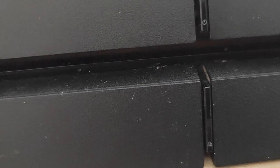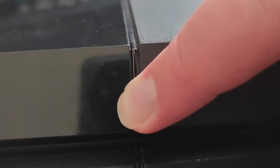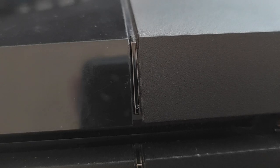On the earlier 1000 and 1100 series machines, these buttons were entirely different. On an 1100 series machine the buttons don't stick out as far — they're flush with the surface of the hard disk drive cover, and they don't click. You can't press them in, they don't make any noise, because they're capacitive. All you can do is rest your finger on them. So if your buttons are like this and you can't click them in — you can only rub your finger along them — that's a 1100 series machine and you need to follow a different tutorial, because getting the base off those is completely different to getting the base off a 1200.